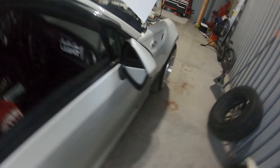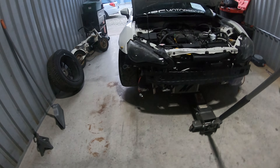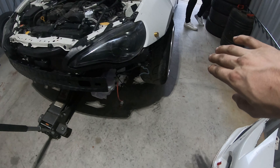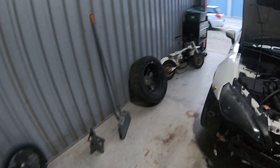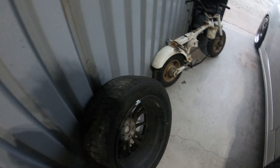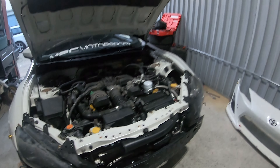I had this thing running for a while and oil temperature does work - it was slowly rising. So now I'm gonna do the alignment. I kind of eyeballed it and it looked like this wheel had a little bit of toe out, so I gave it a little bit of toe in. I'm gonna use these snow tires to do the alignment because the wheels I tried before were all chopped up - these will give me a better idea of what I'm actually doing.